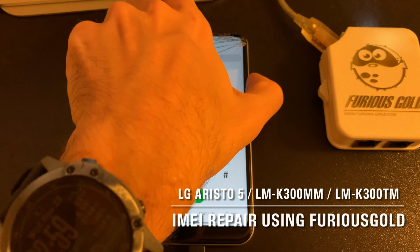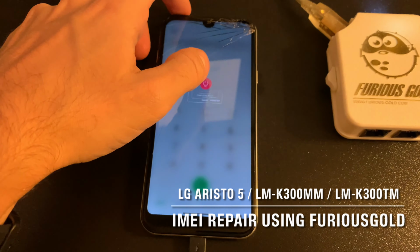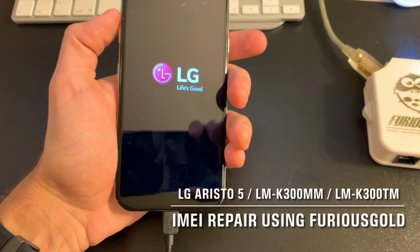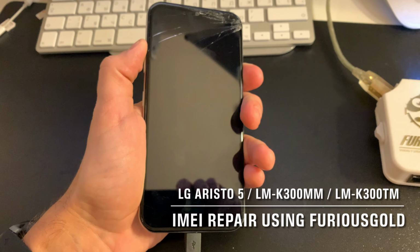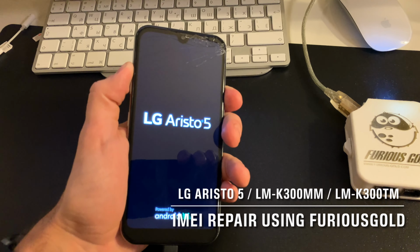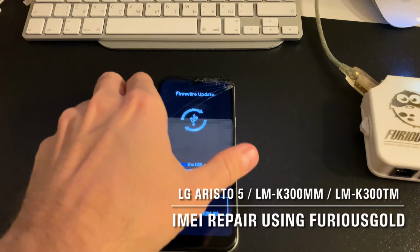So we start by powering off the device, and now by having the USB cable inserted, we keep pressing the volume up until the phone enters firmware update mode, as you can see.